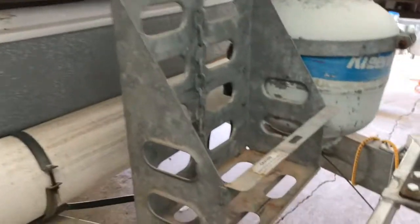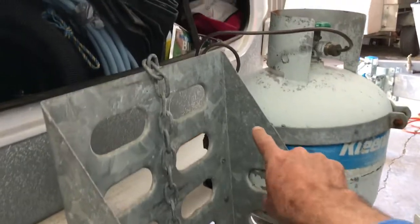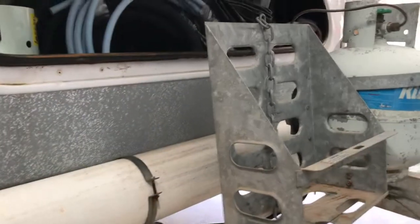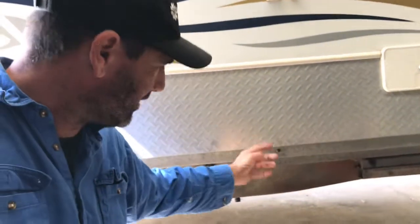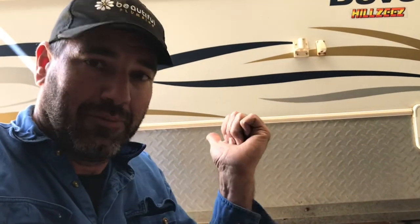So I suggested: we've got this water jerry can at the front — if we just cut that out, we could put a cradle in there for the four kilogram bottle, mount a new regulator with a new hose, and get that LPG bottle out of the storage compartment and into the front properly. He also bought a Kick-Ass hot water system that we want to hang on the side — not permanently — with a gas bayonet underneath and a water feed from the camper pump. We'll also fit a BBQ bayonet on the other side, which only takes another half hour to 45 minutes.